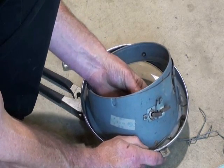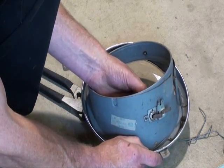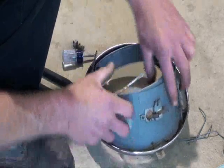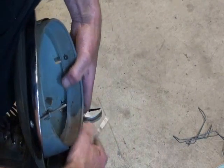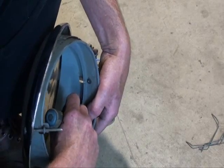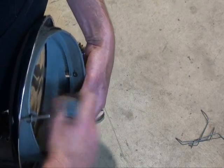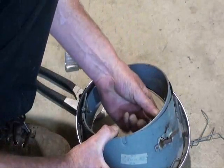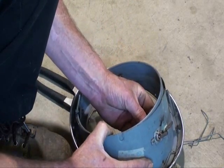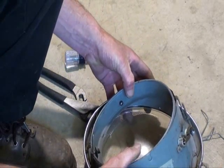I think you can buy aftermarket complete headlight bucket assemblies. While we're in here, we're going to give this contact point a little scratch with the end of the screwdriver to make sure there's no corrosion on it. Hopefully it'll work. Bulbs in place, then we'll throw a new headlight in it.